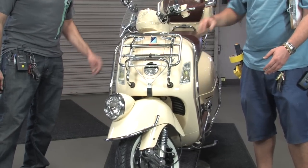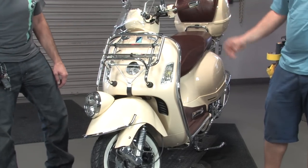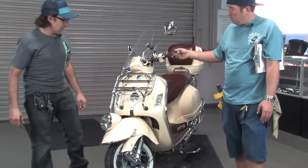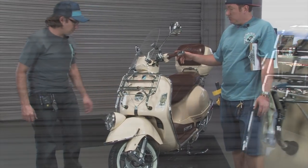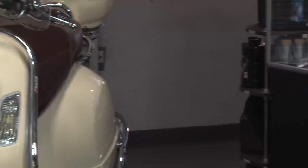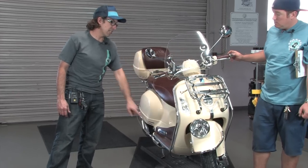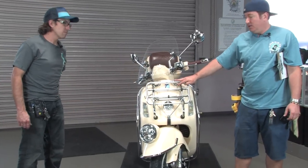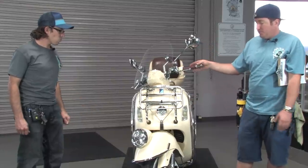So how did the installation go, Robot? Pretty easy install. Put the rack on first. The trickiest part is a little strap that hooks into the pocket where the fender goes up into the fork. Then you torque the two strut bars enough to get the clearance between the bar and the fender. There's also an extra nut that locks it in — very sturdy. Sometimes you need to turn the rubber pucks to get them to line up. The bars go on straightforward — there's a bracket that bolts to the underside of the frame, and you need to pop out one rubber frame plug to install that bracket. The bars are two pieces bolting to the bottom bracket and the rack. No drilling — it's all clamp-on, so no modifications to the frame.